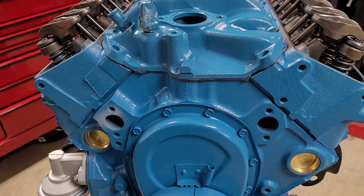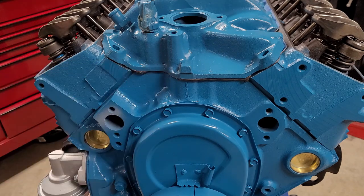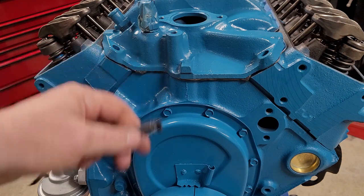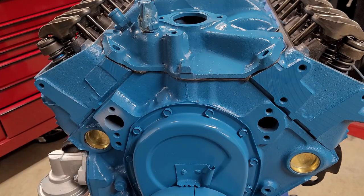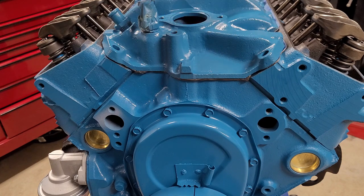Or even put your intake manifold on and take a look at it without it being torqued down, and make sure you get the appropriate amount of silicone or ultra black or gasket maker, whatever it is you're using. Or you could just use these if you're using a cast iron intake manifold, if you like. It's totally up to you. We're going to get this bolted on. Remember, our center bolts all go through, not the end ones, to the lifter valley, the oil. So we're going to put a little bit of silver or ultra black on them as well when we install them.